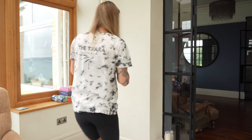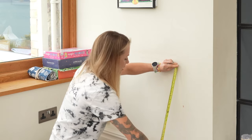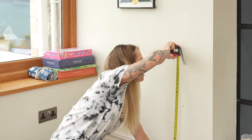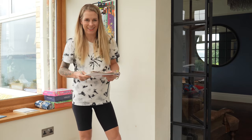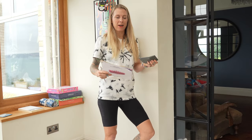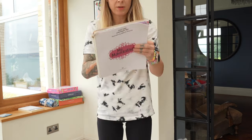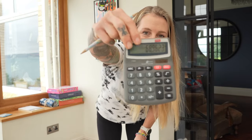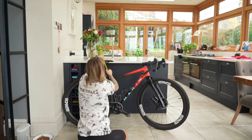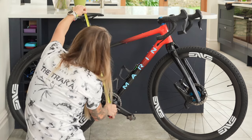Then you get your tape measure and you measure from your mark down to the floor. Then it's time to do the maths. Now if you are good at maths perhaps you could do this in your head — I'm going to go grab a calculator. So now all I've got to do is multiply my inseam length by 0.883 and that should give me the correct saddle height. 78.1 times 0.883 equals 68.9. Let's grab a tape measure and see if I've got my saddle in the right place. You need to measure from the middle of your saddle down to the middle of your bottom bracket. 69 — so that's spot on.